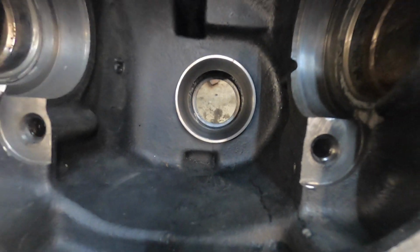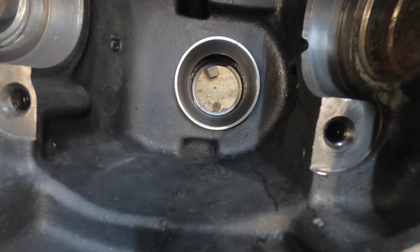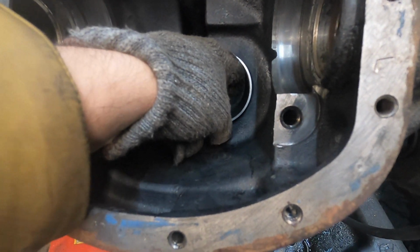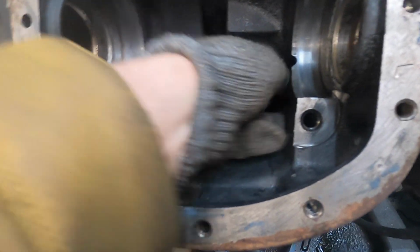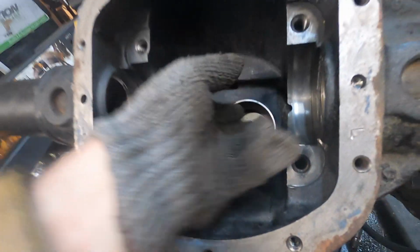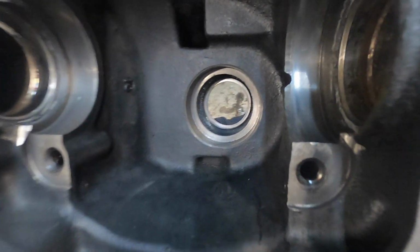I didn't just do this with the belt sander. I lapped it several times with the little sander. But at some point I decided to take it over to my grinding wheel. I just went over it a couple times, and then I polished the OD, and finally kept working with it on the sander, and now it fits about the way I want it to fit. It's tight. I do have to use a punch to get it out of there, but that's about the right amount of force I want dealing with this thing.